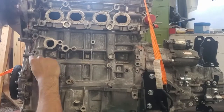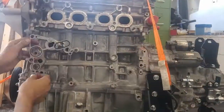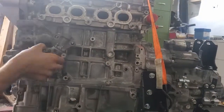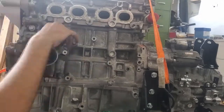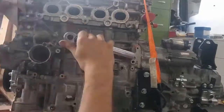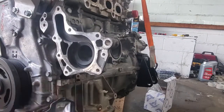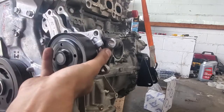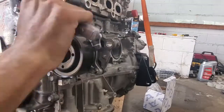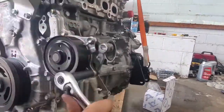On to the accessories. I'm cleaning the dried gunk off the rubber gasket for the water pump housing — it's important to get this off as it won't let the rubber form correctly and may result in a leak. The mechanical water pump housing fits here just like on the non-hybrid engines. You can get this housing used, then install the actual pump which should be new. ASIN also has these. This bolts on and gets torqued in a pattern — don't forget the thin gasket between it and the pump housing that should be supplied by the manufacturer.